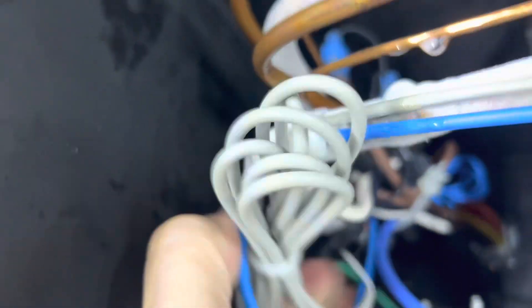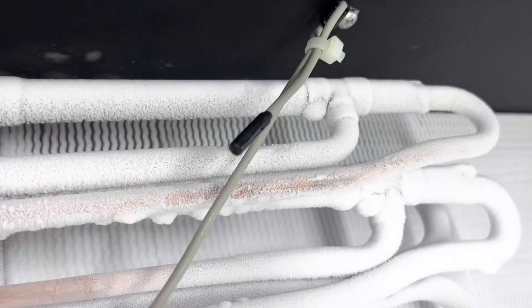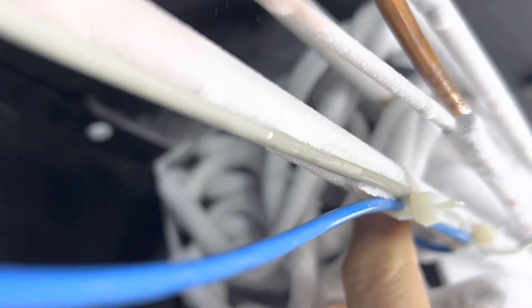There's a wiring harness to sort out back here. There are multiple orange wires, but only one red wire, which is good. Even better, these probes may be on jumpers I can just change at the jumpers. Here's your cabinet temp right here, and the other one should be strapped to the suction line — it's this blue one right here. If we break that loose and make it the air temperature sensor, let me cut these zip ties to get a better look. There's the orange wiring coming in.